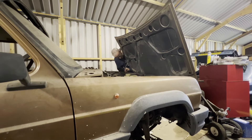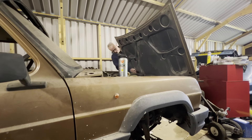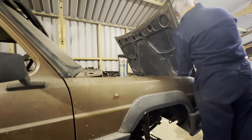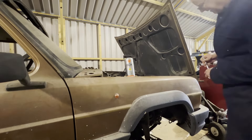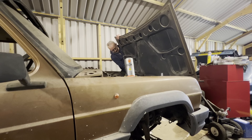The first step is to see if the engine has seized and that means taking out the spark plugs. Front hinge bonnets like this are all very handy for not flying up if the latch lets go at high speed, but they do get slightly in the way of major maintenance tasks. So I'm going to take it off with the aid of some of my trusty Bulldog BDX penetrating fluid to help release the bolts.